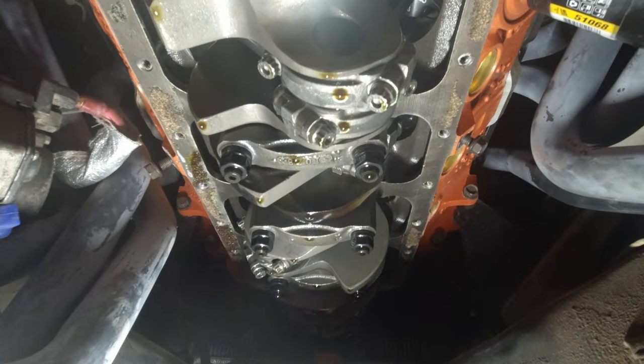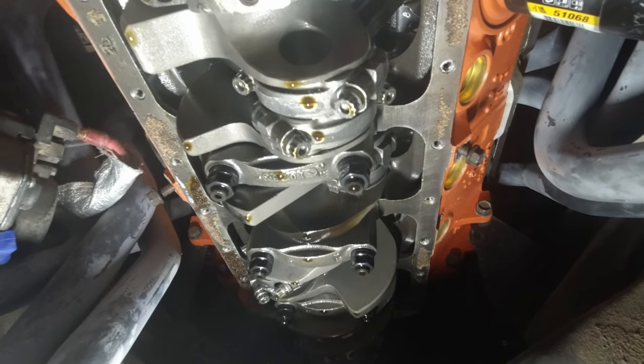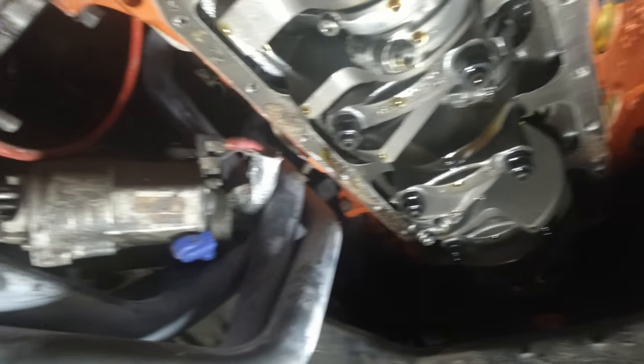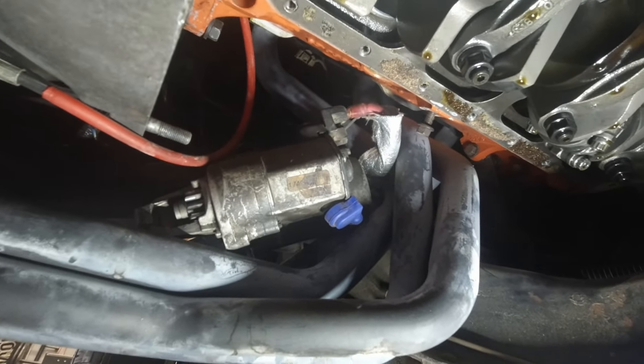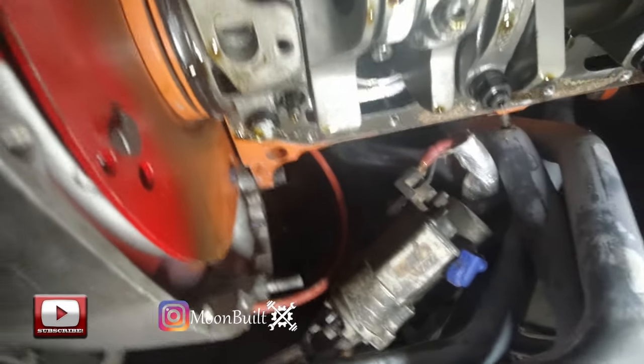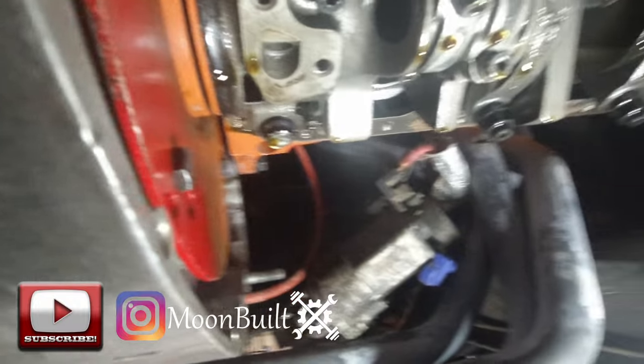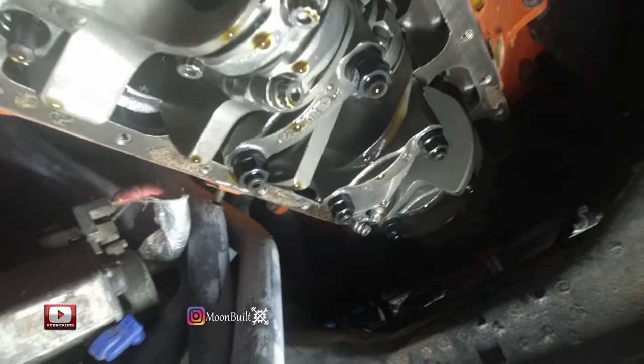In the case of these old Dodge pickups — and I believe any Dodge pickup with a V8, correct me if I'm wrong, leave a comment below — you can replace your rear main seal without too much difficulty. The first thing you've got to do is pull your pan. On these trucks with a V8, whether it be a 318 or 360, first you've got to pull your starter — I've got mine sitting on the header — then pull the cover off your transmission.